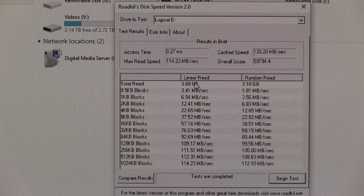Right at the very beginning it starts off at about 3.41 megabytes per second for half-K blocks, which is ridiculously slow, but it's not optimized for that — you'll be spending more time setting up for the read than actually doing the read. At the top end, more of the speed is dominated by actual data transfers rather than IO overhead, seeking, and accessing the disk. I think you can see here that we are actually meeting the requirements of the drive specifications. Let's pull up the datasheet and have a quick look.